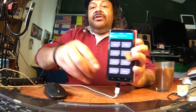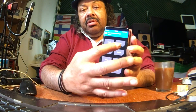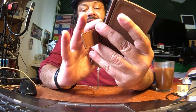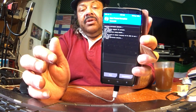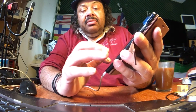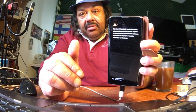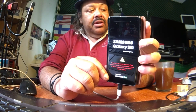So what I'm going to do now is copy the 3.2. But first thing we have to do is hit Wipe, then select Format Data, and type yes. The phone will be wiped. Now we're going to hit the home button and reboot back into recovery. We hit power to continue, and that will bring us into recovery mode.